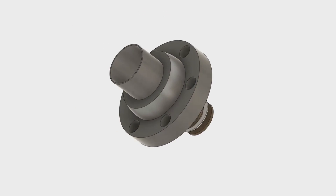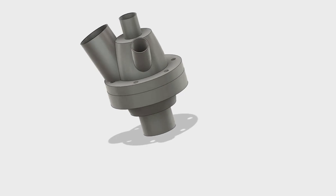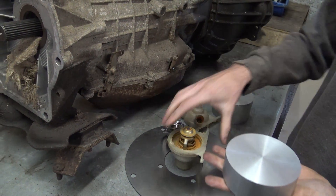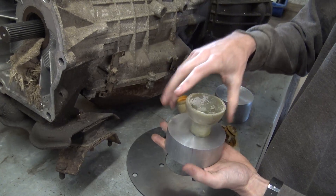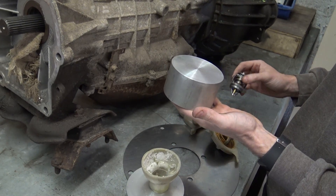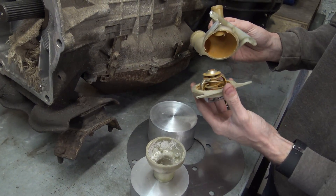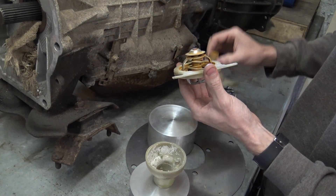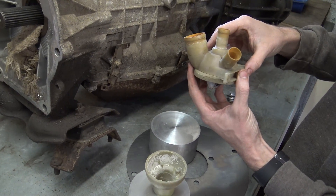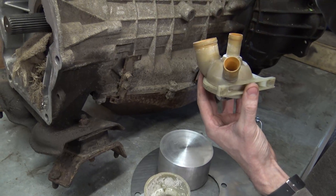I've done a CAD model of this now because I wanted to teach myself a bit of CAD as well - it was a nice little project. So hopefully there's an animated spinning thing on screen of that. These are the two slugs of metal I'll be using to machine it from. This will be the base - a nice simple section with a lip around it with a bolt pattern. The upper section, which will house the thermostat, will be made from this slug here. To figure it all out I had to cut an original thermostat to pieces. You can see the secondary plate there - when the thermostat opens, it shuts off the bypass and ensures all water goes through the radiator from the top hose. Whereas when the thermostat is closed, no water goes through the radiator and everything goes through the bypass tube.